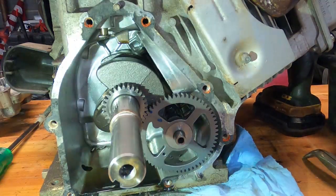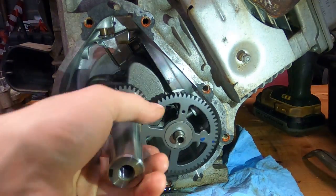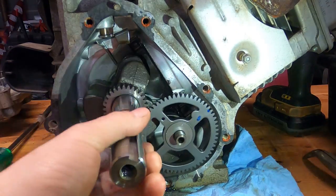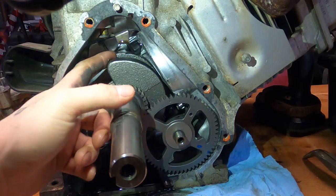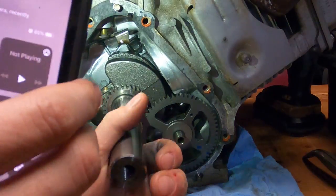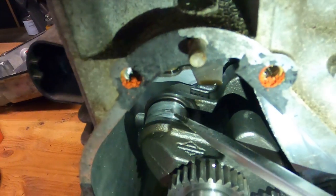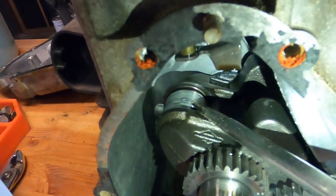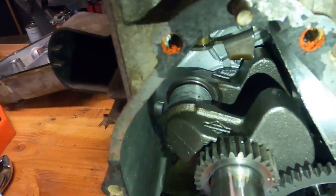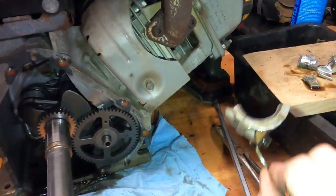Let's talk good news, bad news. These gears right here look absolutely fine. The scraping you hear is the flywheel on the other side — there's rust built up. The counterweight looks fine; it does have a dinger in it but I don't think long-term that would be a big issue. The actual journal is not good at all — there's no saving that. You can see all the scoring right there. This thing was starved for oil, it ate through its bearing, ate through its connecting rod, and at a certain point there was so much clearance it was binging and banging back and forth until she gave up the ghost and exploded.